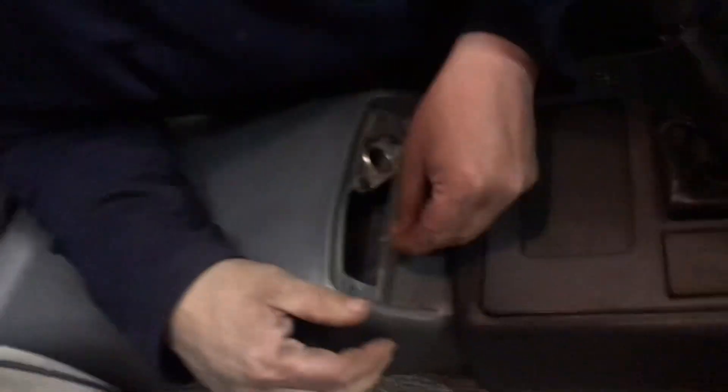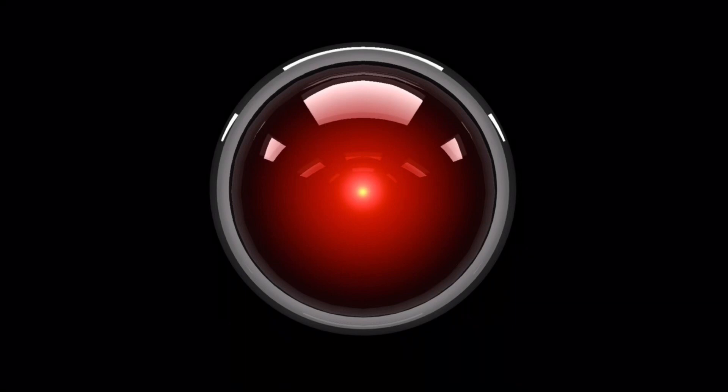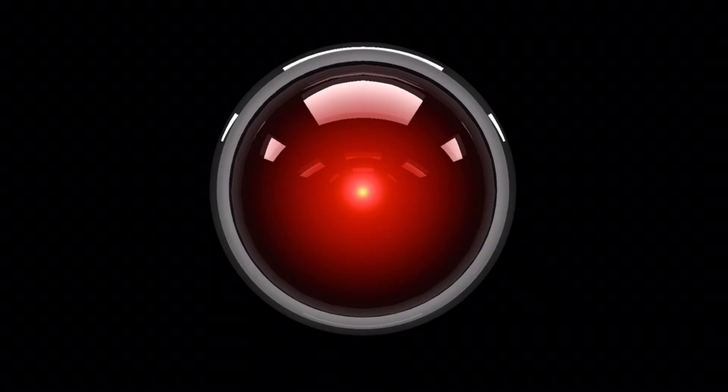You may be wondering: why do I have to remove that plate and put a paperclip in the ALDL? The ALDL is connected to your ECM — the ECM is the brain box, basically the computer of your Fiero. If you're trying to manually adjust the timing, the computer will fight against you. You need to put the paperclip in the ALDL to trick your computer into not doing its job.